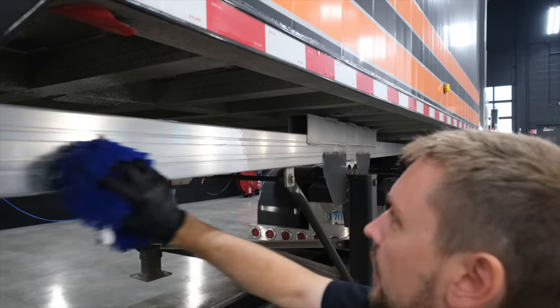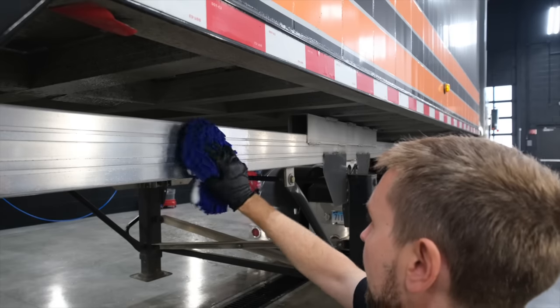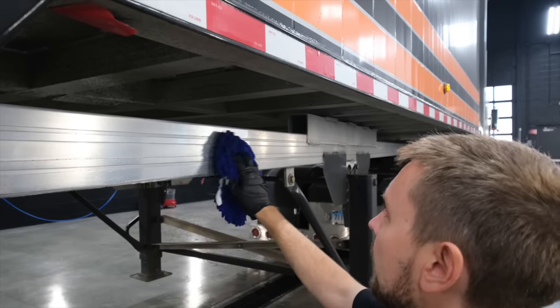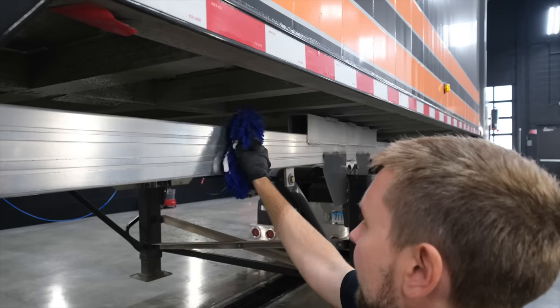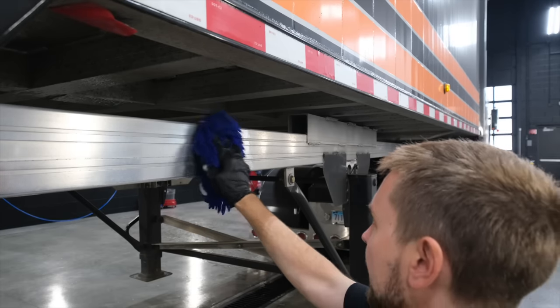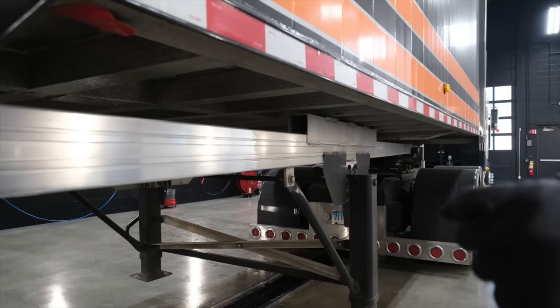This is not a polish. It will not polish unpolished aluminum. It will only get the junk off of the surface of aluminum that has been polished in its past. And it won't etch the aluminum or turn it white or anything like that. You just want to make sure that the aluminum isn't hot. If it's a thin aluminum, especially like a fuel tank, because you'll see some streaks. And that's not what you want. Let's rinse that off, see what we got.